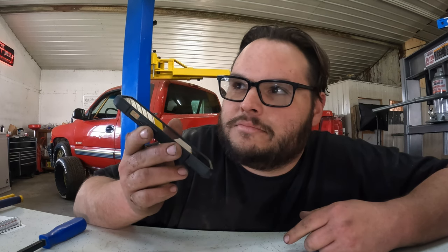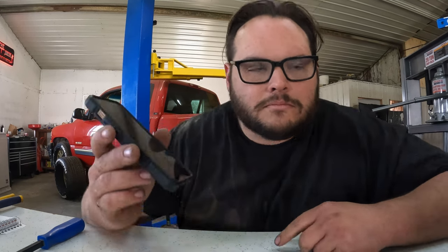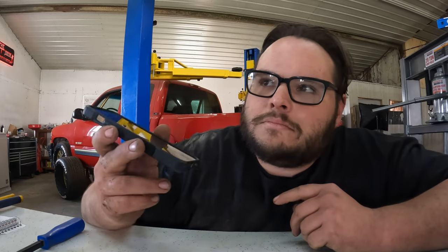Actually, honestly, what are your thoughts on crush sleeve eliminators? I prefer them. Yeah, that's kind of what I'm thinking right now. I'm kind of over this whole crush sleeve thing. Every re-gear I've done, I've done a crush sleeve eliminator in it. The only time I ever used crush sleeves was when I was in school learning how to do it initially. It just involves a lot more putting it together and taking it apart.